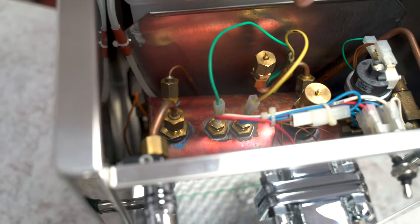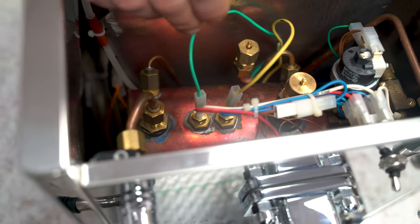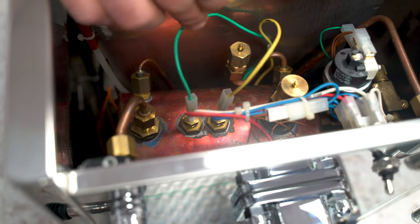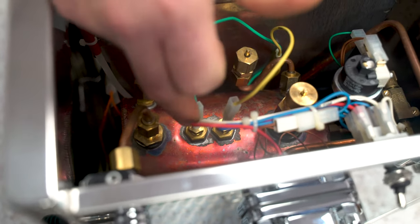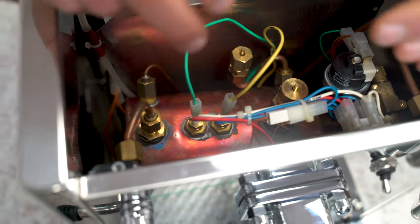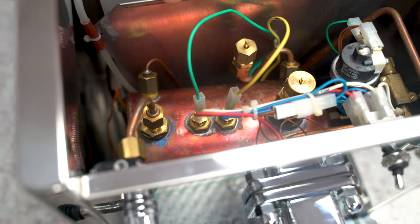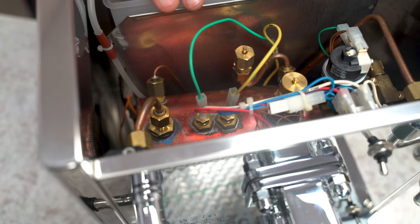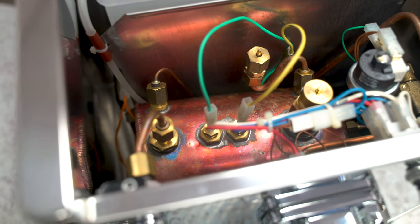When I reconnect, you hear the click — that means the heating element almost turned on and the light turned back on. This is how we test the machines to make sure the min and max work. If you're using purified, distilled, or reverse osmosis water, the five volts can't pass through the rod through the water because it's too pure. The other sensor is actually the boiler wall, and if electricity can't reach it, the machine shuts down.